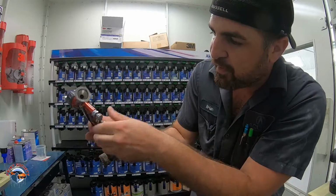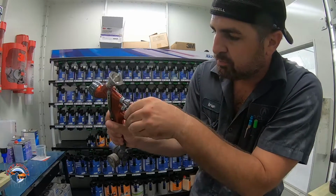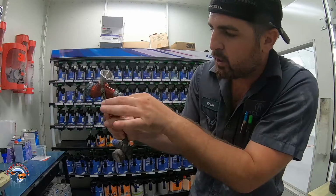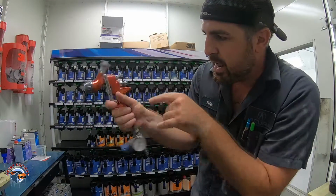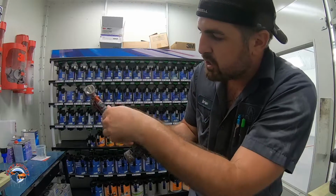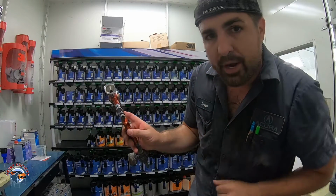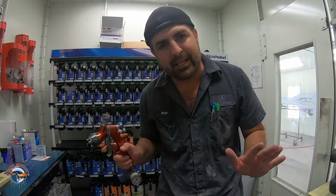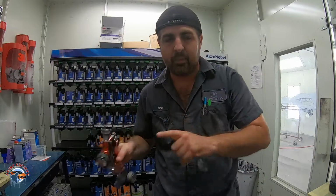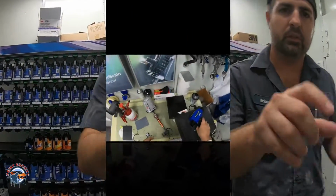As soon as you feel pressure or resistance on the trigger, right now, if I can't move it, I know I'm wide open now, okay? So I'm gonna go one turn from wide open. My gun is set up. I'm gonna run this around 26 PSI. Get the sealer mixed up. Let's start to apply it.